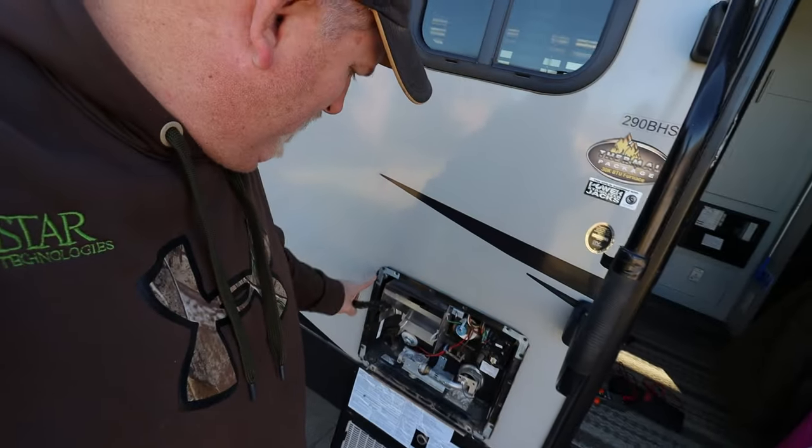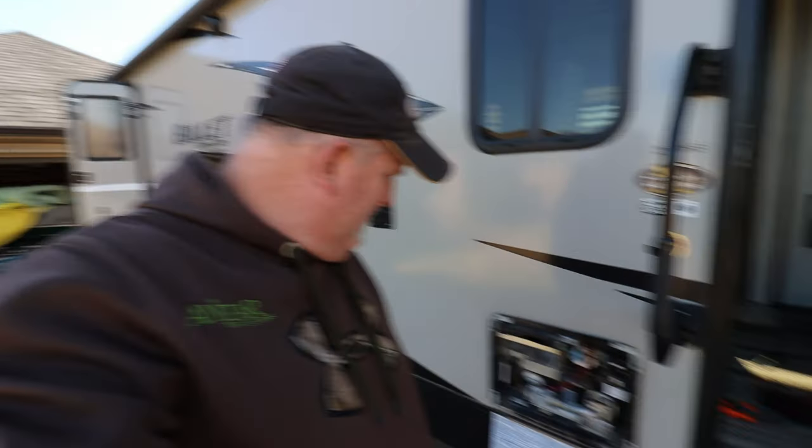In order to gain access to my hot water heater tank, there's an access panel. I need to remove these screws to gain access. As you can see, it's kind of tight in the panel - there's the cold water line that comes in, and it looks like behind that box is where the heating element is, actually down below. It may be easier to remove the lines and slide the tank out. So I'm going to go ahead and remove all these and pull the whole thing out to gain access to the heating element on the back side.